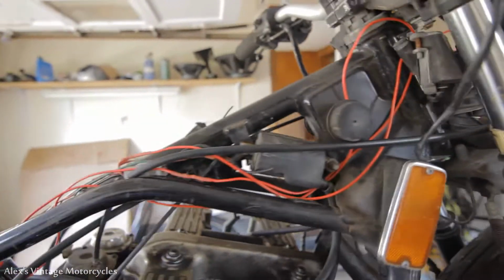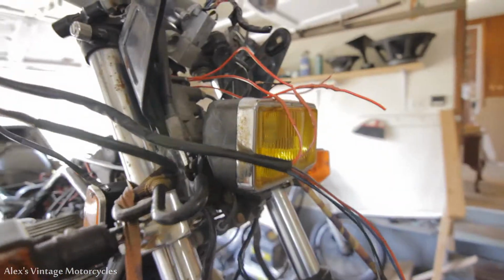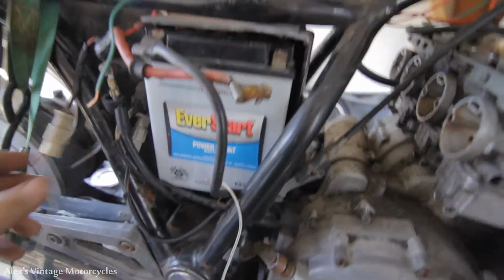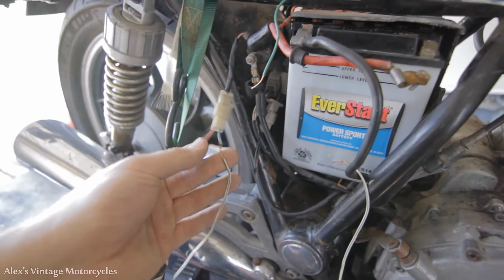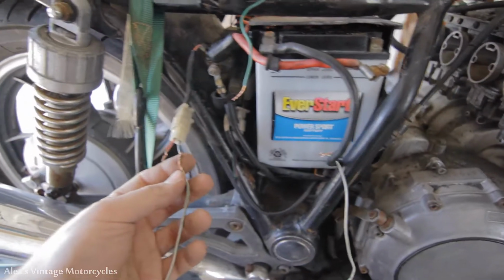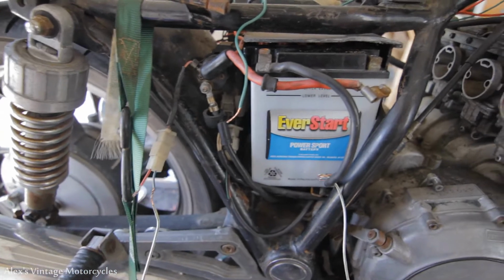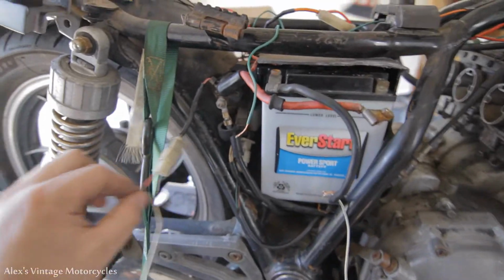So it's gonna keep rolling here. What am I gonna do next? Let's see. Probably start messing with the headlight stuff. I'm gonna go get the start switch and put it in the headlight, and I'll have to run these wires, which activate the solenoid, up to that momentary switch. Actually, you can just ground one of these to whatever, and then all you need is a hot supply through the momentary switch to pop the solenoid to start the bike.